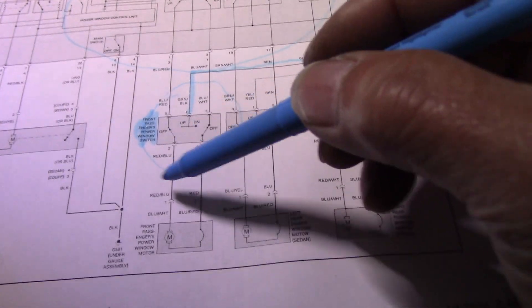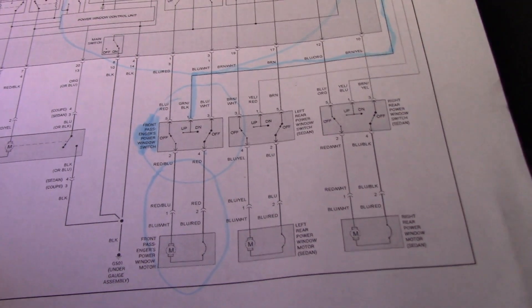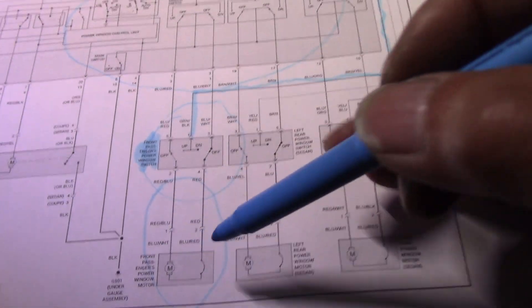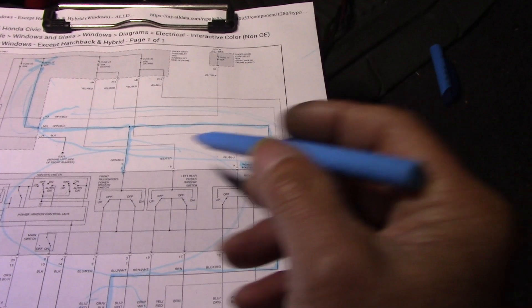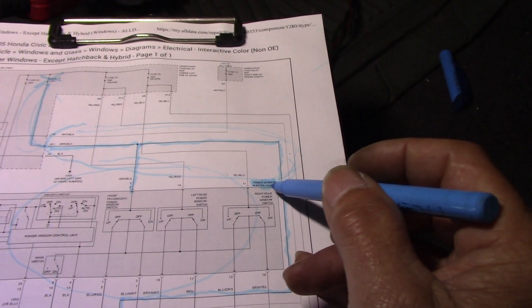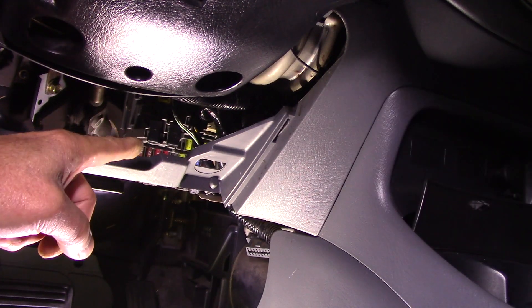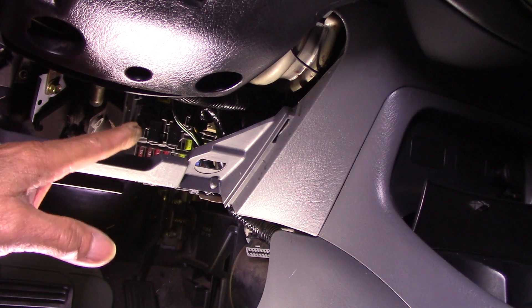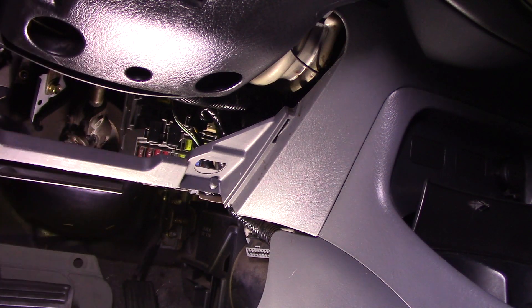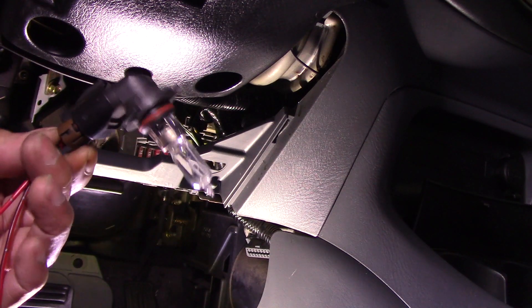We need to find where the wire is touching body ground - inside the fuse box, from the passenger front switch, or inside the motor. I don't think it's the motor because he told me he jumped power directly and the motor goes up and down fine. So what I'd like to do - I don't need to tear off the passenger window panel because it's too much work. I believe him for now. I'll go to the master switch by the driver door and check from there. I will connect the headlight like this for more power to check, to see exactly if it's short or not.